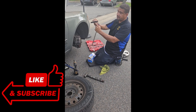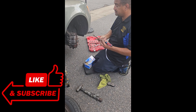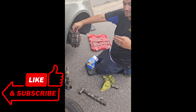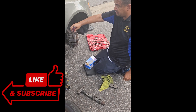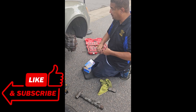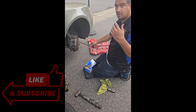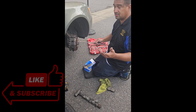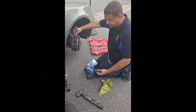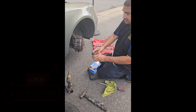You can see this is part of the brake itself, and this is the thickness of the brake. If you look at this particular car — when inspectors do inspections for your inspection sticker, they look at an inspection port sitting right here. That's your caliper, and the piston is only going to come out so far. If you drive the car too far and this caliper piston comes out too far and I cannot push it back in, now you're replacing a caliper — adding $200 something dollars that you didn't have to spend. On this particular car, the thickness of the brake is about the thickness of a bologna slice.